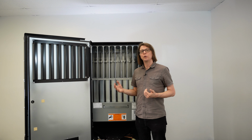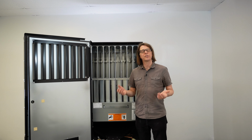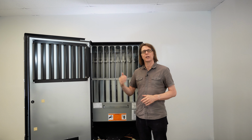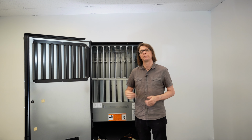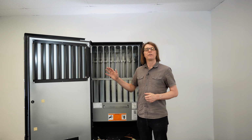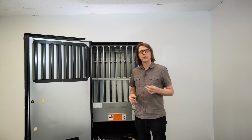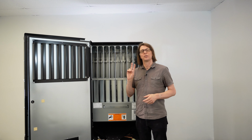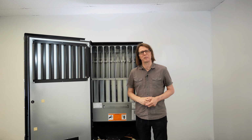On our selection 2 is a 16-ounce can, so we're going to set that for set depth 3 because we're loading it 3 columns deep or 3 products deep. Now selections 3 and 4, those are loaded 2 deep, so the set depth for those 2 selections will need to be set to 2. So let me show you how you do that.